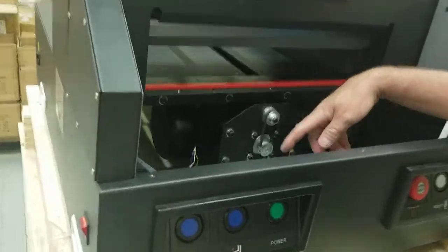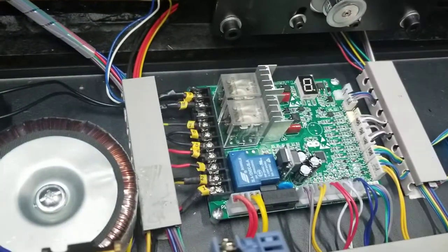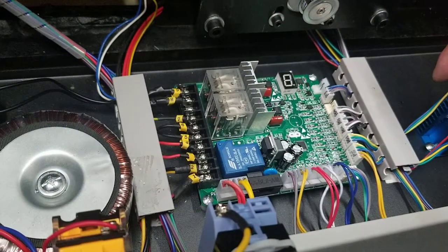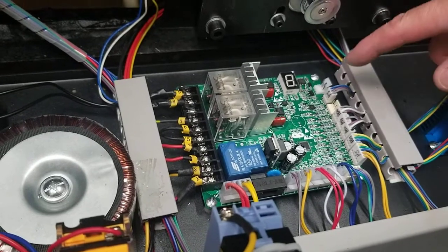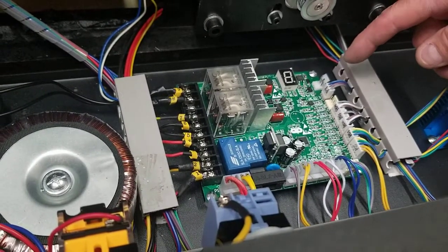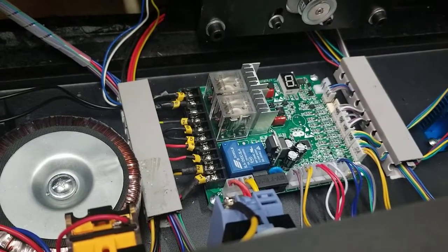What we're going to be replacing is the motherboard, right here in the center. It's pretty simple — you've got all these wires on three sides of it, the front and the two sides. These should all be marked and I'll go through that in the video. The main thing to watch for is making sure you get these plugs back in the same order.